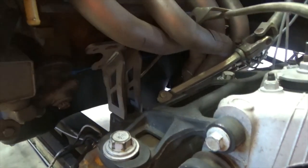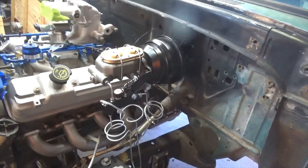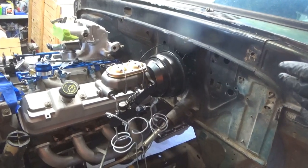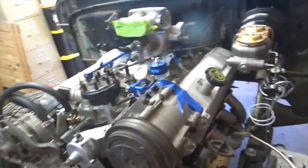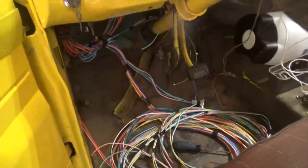Running Pirate Jack's brake kit to put power brakes on it. I haven't used the Crown Vic power brake setup because these bolt right into the brackets — it was a no-brainer. I've done the customized dash, I'm waiting on the steering. I've got a new 21-circuit wiring harness laid in there that's halfway installed.